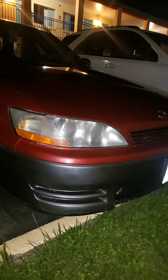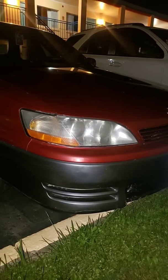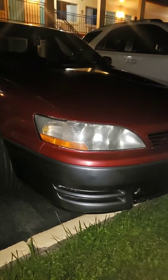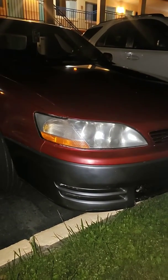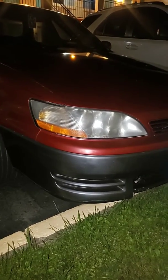I'm gonna be working on my headlights. They were okay but I tried to clean them with 1500 grit sandpaper and it kind of made them foggy. I got 3000 grit right now and I'll try to fix them tomorrow. I also got a restoration kit for the headlights with a clear coat and everything.